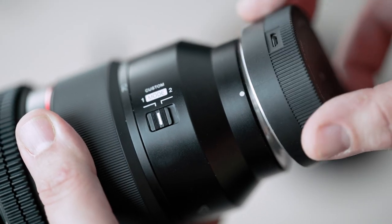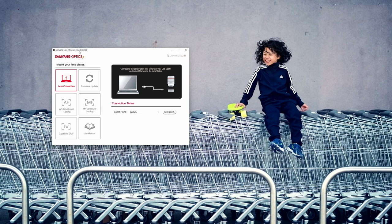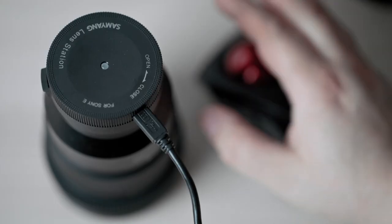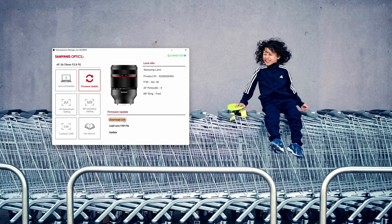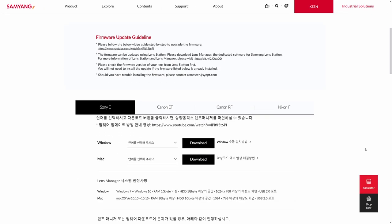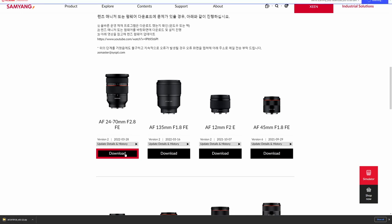To update your lens, simply connect the lens station to your computer via a USB cable and attach the lens to it — just the same way you would mount a camera. Align the white dots and turn the lens until it clicks in. On your computer, fire up the Samyang Lens Manager and make sure it's at least version 2.66. Under the lens connection tab, make sure the COM port is set to the right one, then press 'Lens Connect.' Once connected, the green light on top of the lens station will light up. In the lens manager, choose firmware update — you'll be presented with a download link to the Samyang website. Find the AF2470 f2.8 and download the latest firmware.